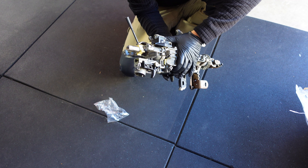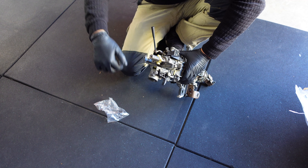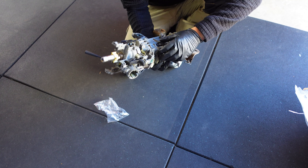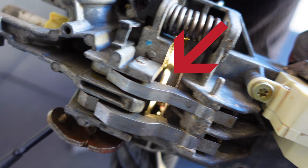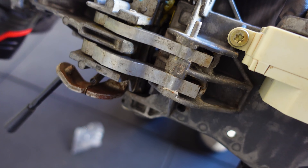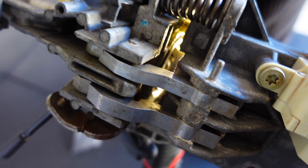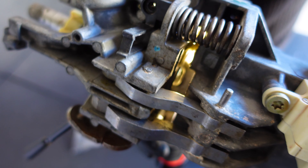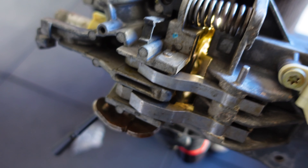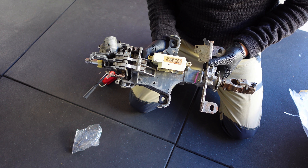The issue I've got with mine is that this shaft is very loose. When the steering wheel is attached, the shaft has a lot of free play, and the reason is there's a joint, a knuckle that rotates, and the joint on mine has unfortunately come loose. I don't know whether one of the pins has come out or these just wear out over time - if you know the reason please comment below. Basically, I'm going to need to swap this steering column out.